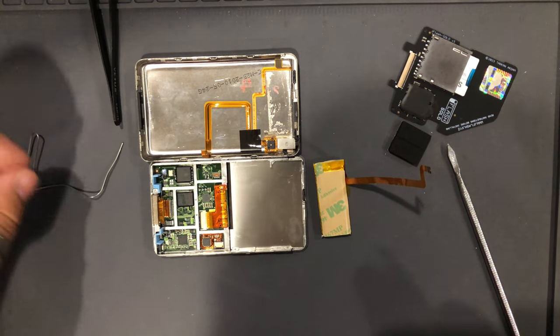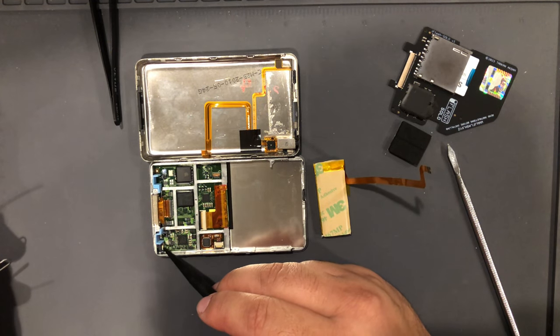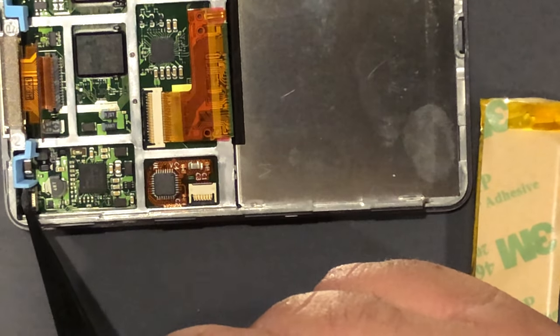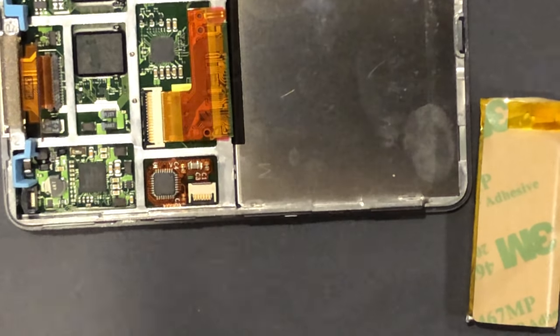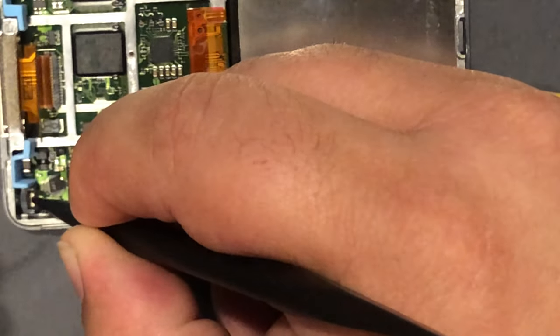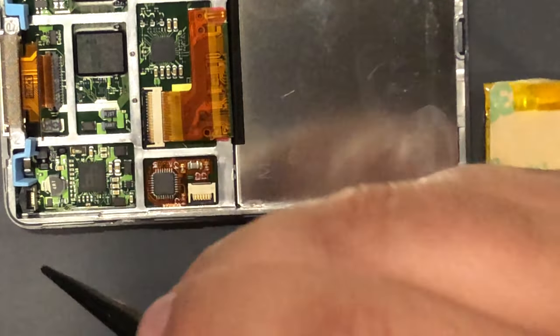Now, we need to release the battery clip again. Zoom back in. Okay, so again, people will just kind of take a spudger to raise this battery clip, and again, they'll end up tearing it off. So what I like to do, take a spudger, kind of hold down on that white part, take my handy dandy little paper clip. There you go, that's all it is.